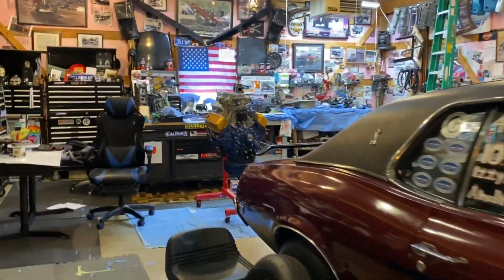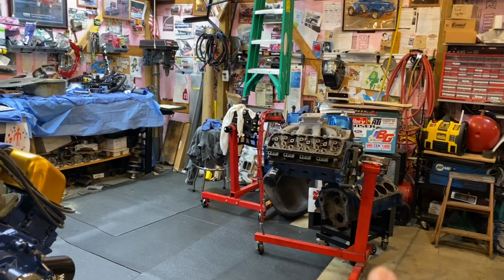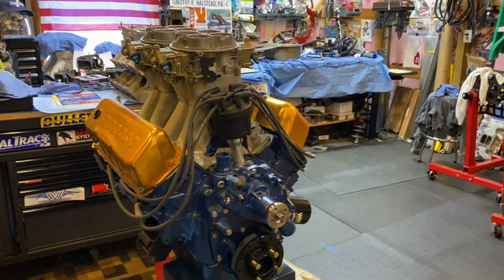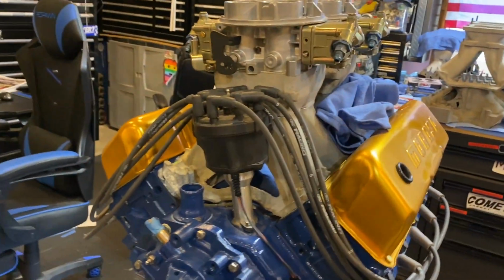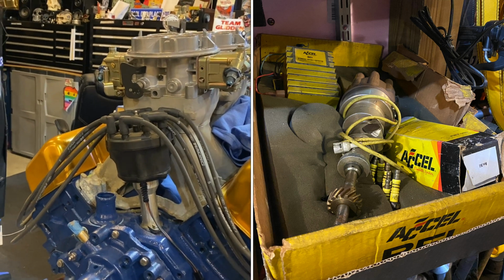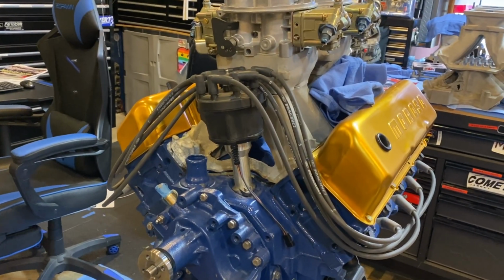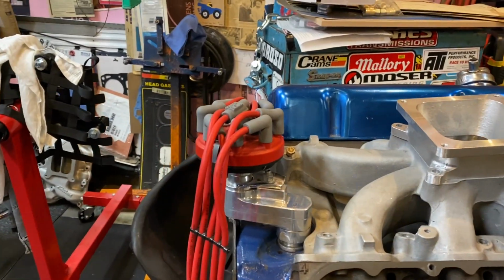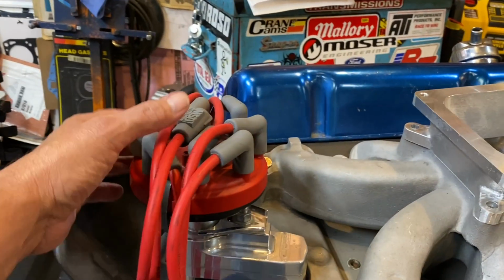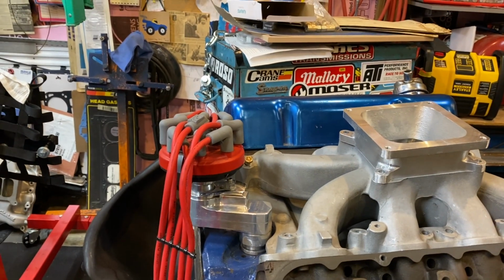So now that the Holley Strip Dominator is almost finished ported for it, once I get that adapter plate finished that we had just talked about, then what I'll do is I may try to fit this tunnel ram on here. The issue is this big distributor, which I'm not really a fan of, but I have another distributor that came with the Mustang I may use, and it's an old Excel, if that works with it. Or I may even try to incorporate this right angle Schwartz distributor, which is an offset distributor. It's great for tunnel rams, and that's why it was made. I think there's a little belt in here, but then you don't have to worry about clearance with it.